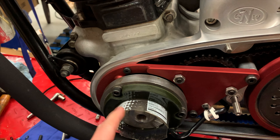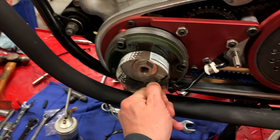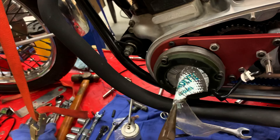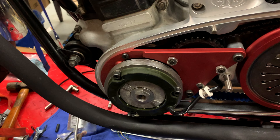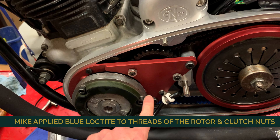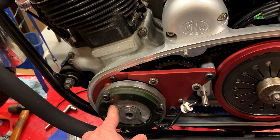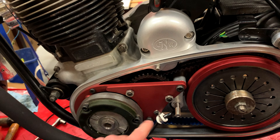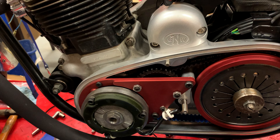This is how I do the spacing for the stators — put that on. It's usually pretty tight, but when you pull it out you know you've got clearance. I've already tightened these down; these get a little bit of blue Loctite on them as well. If you don't use that method of putting it on and running a feeler gauge around there, you might need to lock them down, spin the engine over, and then Loctite them one at a time, which is what is described in the instructions.